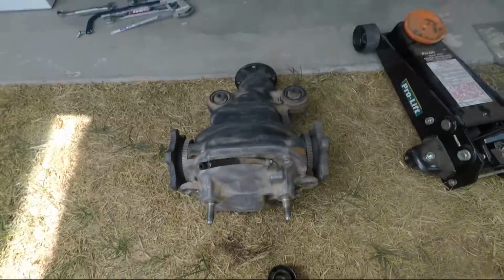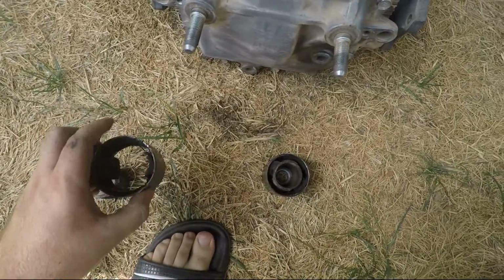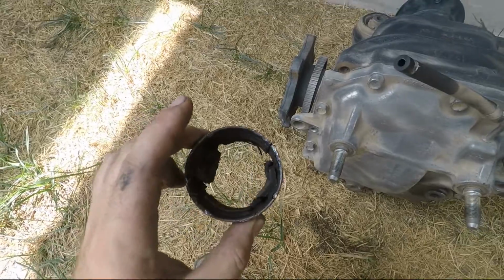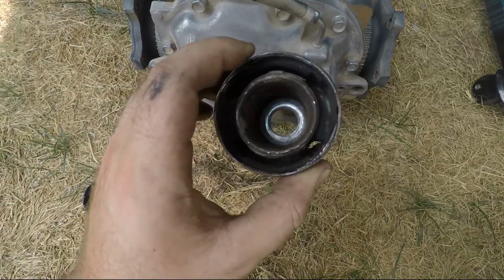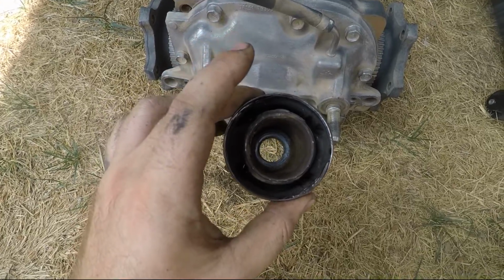So there's the diff out of the Pathfinder. You have to take it out to get access to push these out. Some people say you burn the rubbers out, and this one was completely collapsed. I just pushed it out with my thumb. Whereas this one, well, what does it matter if you burn it out? If you're going to use a Sawzall, yeah, you have to get the center out, but I bought the kit,